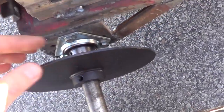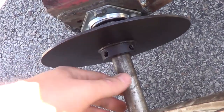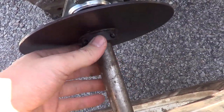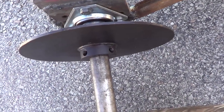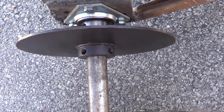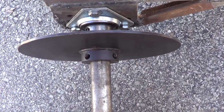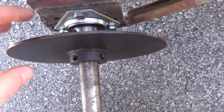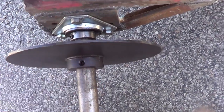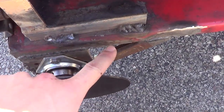The other thing I had to buy was a go-kart brake disc. It's built specifically for a one-inch live axle and utilizes a quarter-inch keyway. If you don't have any key stock, you're going to probably have to buy some — it's dirt cheap, maybe $1.50. You could probably make your own if you really wanted to. You need to stick some keyway in here and get your set screws nice and tight. Special guest today everybody — my brother Max. Alright, let's fire it up.